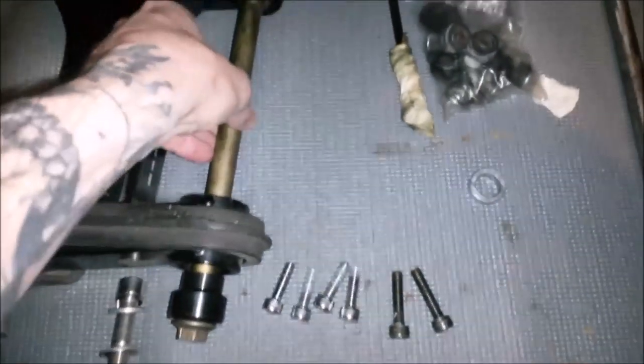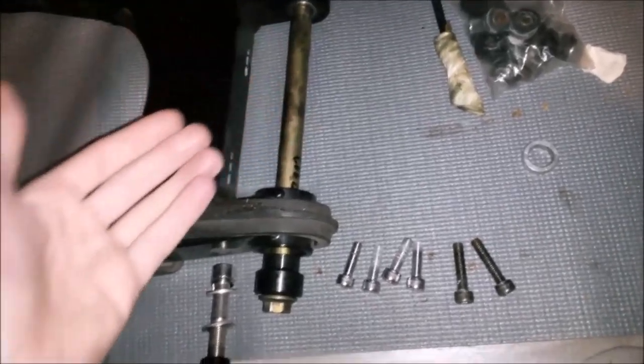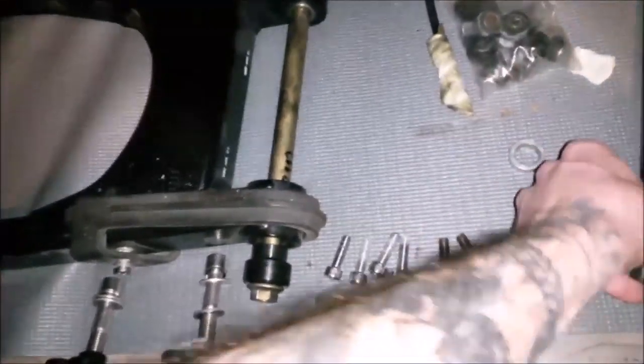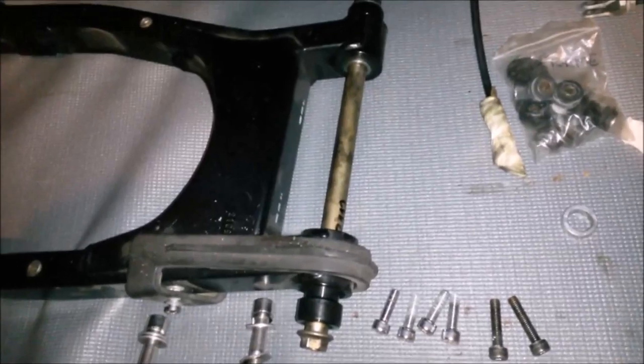And swing arm bolt. So yeah, this was off a, I think this was a Daytona 650, the Daytona 650, 600, Speed 4, TT 600, Bonneville, Scrambler and Thruxton all share the same swing arm spindle part. And as you can see, compared to the one that came with it, which I had my suspicions was not a stock part, yeah, definitely not. Lengths are different. This is just mild steel. Don't know what that's come off. That was just with it. That's just a handy thing for me to have knocking around the tool shed. So I'm pleased I spent the 8 quid and got this with all the nuts and washers. Got the outriggers on there now, all my spacers in place, so that's cool.